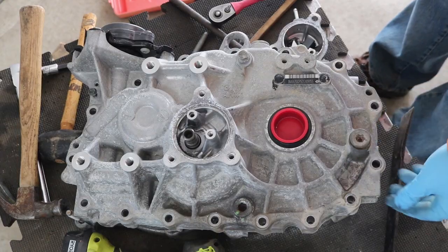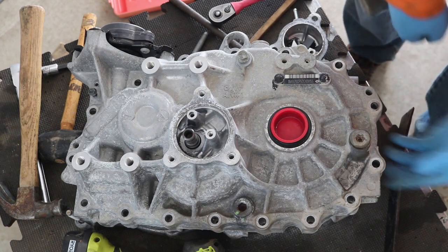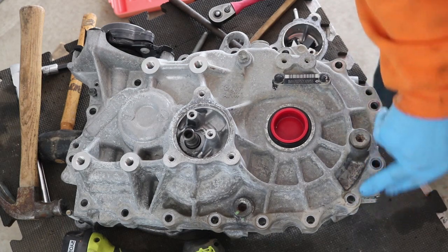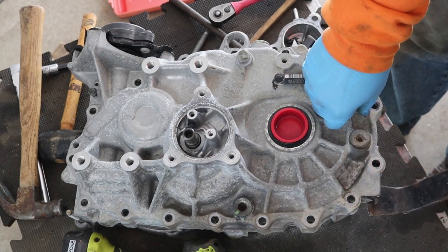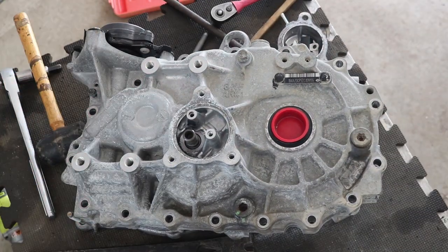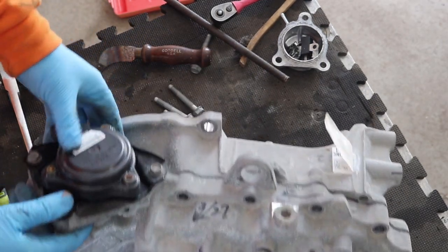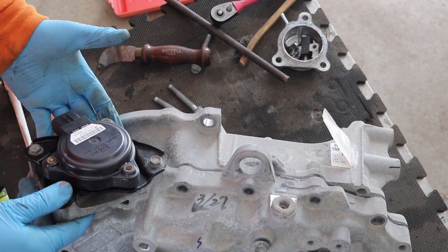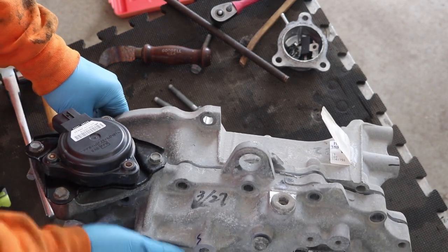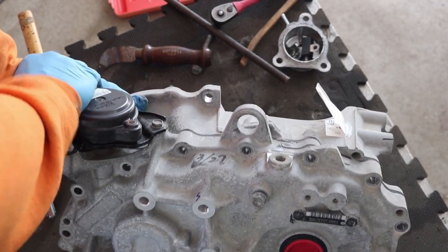That is loose. Now, as far as I can tell, all of the bolts have been pulled out, but it looks like there's a gasketed seal all the way around. Here's a spot where this little corner is on both halves of these castings — looks like a good place as any as a pry point. On the top we've got this black device right here, which is essentially the electronic parking brake. It connects down into here. I don't know if I need to disconnect that or not — it looks like it's just on this half of the casing, but maybe it's holding things together.